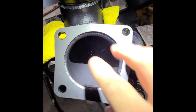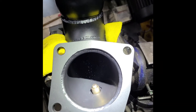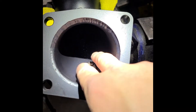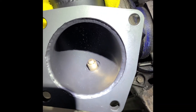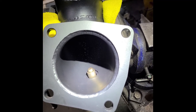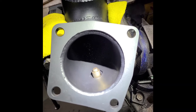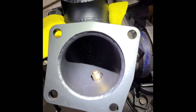This is obviously where the turbo would bolt down, this is where the exhaust goes — comes up, goes out the top of the downpipe, into the exhaust system, out the back of the car. Now, see how this sensor protrudes up? There's a series of holes on the end of it that measure the oxygen content inside your exhaust system. They're not fuel measuring devices, not unburnt fuel devices — everyone refers to them as air fuel monitoring, but no, they measure oxygen. That's all they do. It's an oxygen sensor.